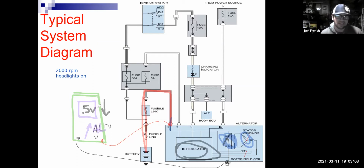So what would you get in that scenario? The battery of the car doesn't really go dead, but maybe the car has weird drivability issues because it's getting this electrical noise. Maybe the alternator seems to make a weird humming noise. Or maybe when you run a lot of your accessories, it just doesn't keep the battery charged like it should. That would be another test you could do of your alternator to determine the health of it based on what's going on with the diodes in it. And all you needed to do was take your meter, hook it up a little bit different way, and now look for some AC voltage, okay?